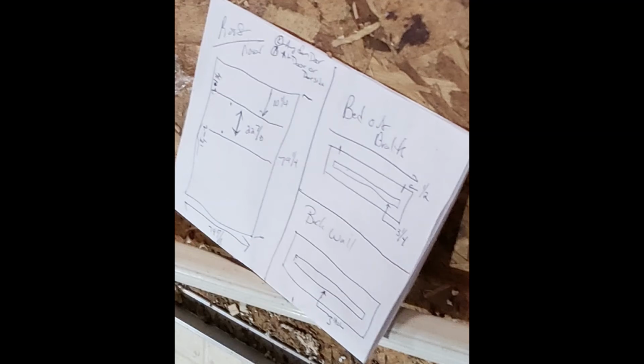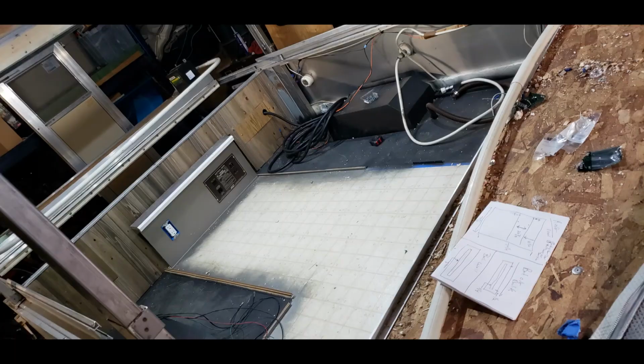Another big thing I highly recommend, especially if you have to get this involved in the renovation, make sure you measure as best you can to each point for each bracket that is on there. I had to remove every bracket, every mounting point, everything. So I made sure to make note of each point so that the end product looks just like this. This is after the brackets had been reinstalled, and all the measurements were perfect so that the canopy wasn't too tight. The door can slide perfect and fit and hang just the way it did originally and lock into all its original sections. And the canopy didn't hang too loose.